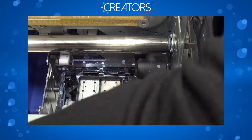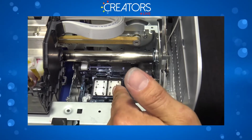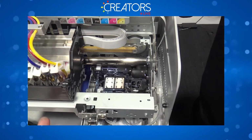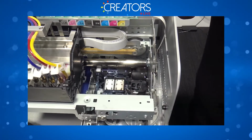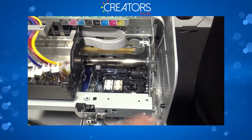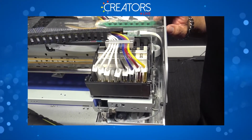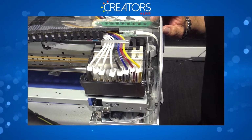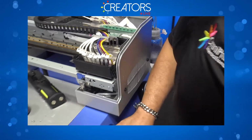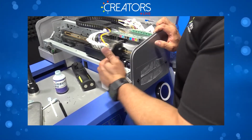you reset your pump. First, empty the capping station, because remember, your undercarriage is already clean, so you don't want to get it wet. Then press function to move the carriage on top of the capping station. Then press function up again to move it up. By doing this, you're resetting the pump.